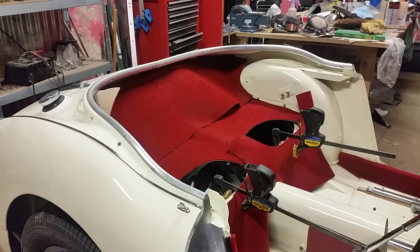For this back section it's kind of like roofing — you start at the bottom and overlap as you go up. There's a really good video online of Matthew Rendell doing this. I've watched it, learned from his mistakes, seen his process, and it looks pretty straightforward. So I'm going to start with this bottom chunk that I have clamped in place, glue it up a bit at a time, and then work my way up from there.